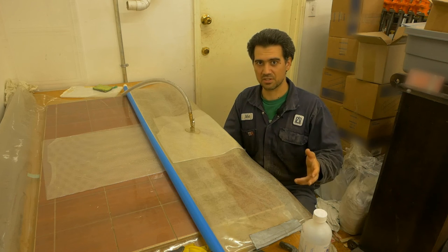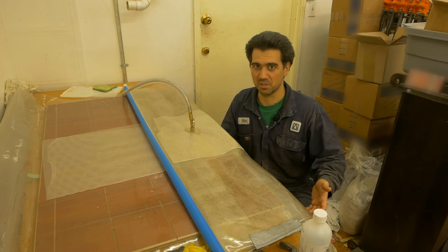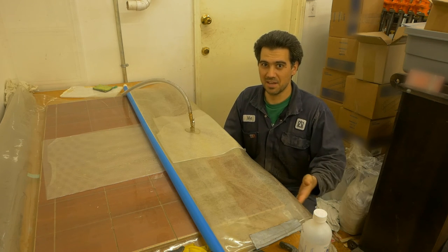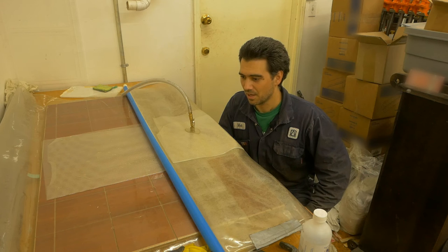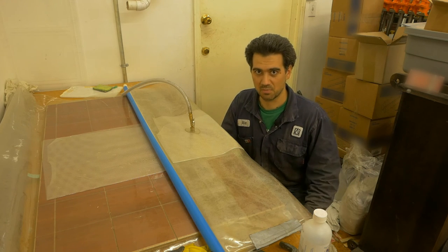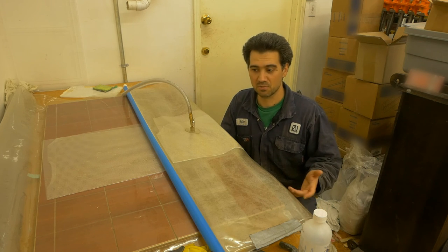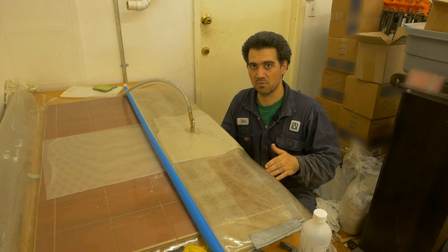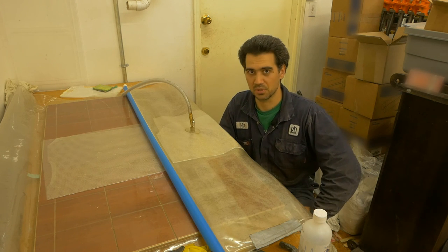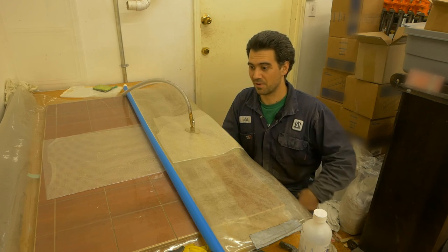You can do this exercise with water, but then you need to do a little bit of cleanup afterwards. With alcohol the area is cleaned immediately, and you apply your masking tape, duct tape, or whatever tape you have on hand. You don't really need anything fancy aside from tape because the air pressure will force that leak sealed once you put the tape on top of it. And that's it — that's how you check for vacuum leaks.